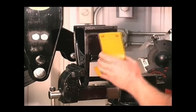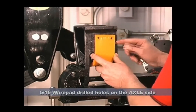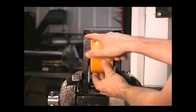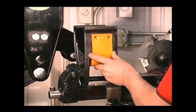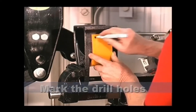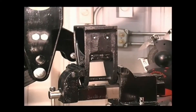Place the hanger wear pad onto the underside of the OEM hanger. The wear pad should be positioned so that the 5/16 wear pad holes are on the axle side of the OEM hanger. Also make sure that the wear pad is in the center of the width of the hanger — the gap should be even on both sides. Using your pre-drilled wear pad holes as a guide, mark the spots that you will be drilling into the OEM hanger. Remove and set aside the hanger wear pad until bolt installation.